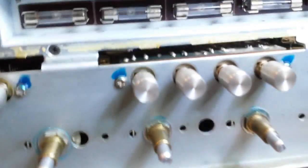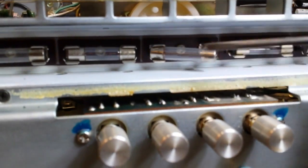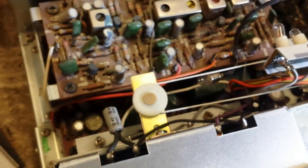Replacing the dial lamps is pretty easy — you're literally just taking a small screwdriver or a fancy dental tool and just prying them out here. The other one is a little more of a challenge. You have to undo those two screws, slide this out, and you may want to take loose the AM radio board here to give you a little more space. You're probably going to have to use hemostats to change the bulbs in these.